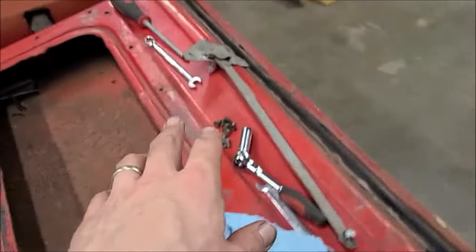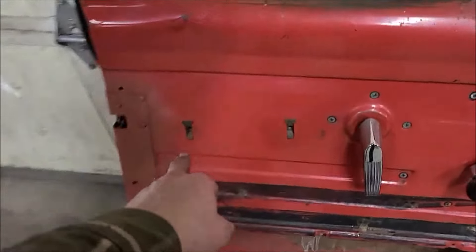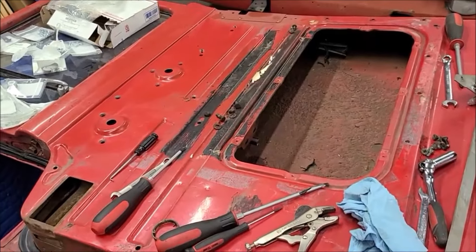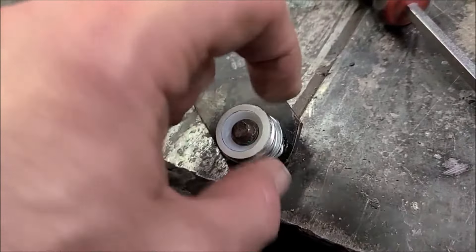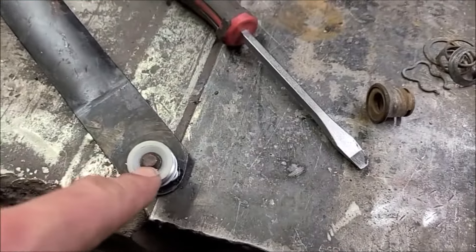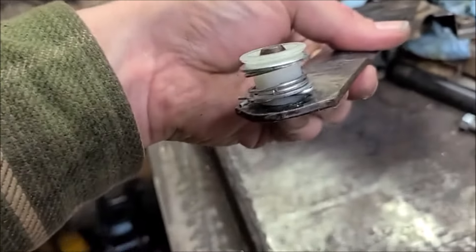The next step will be to put the door handle mechanism in first, then replace the follower guide on here with the new nylon one, reassemble, and then lastly transfer the armrest holes to the passenger door. Let me show you the roller real fast — there's a keeper that holds these on. You pop that keeper out and then this whole thing slides off. You can see the little tab on there, this little piece slides in there, and there's a groove on the inside. The original one is metal but the replacements are all nylon — pretty quick and easy.